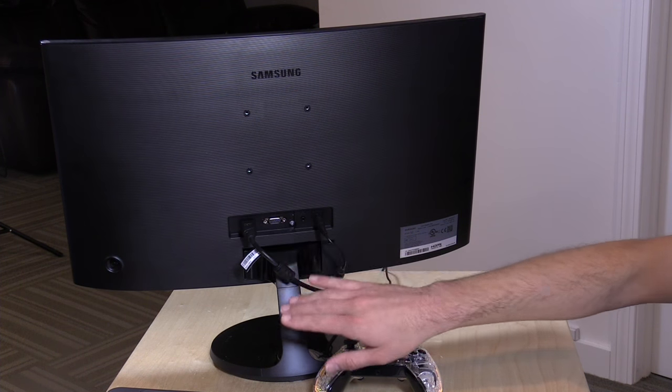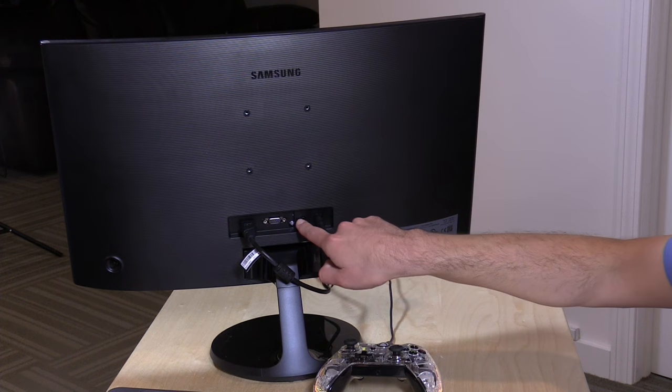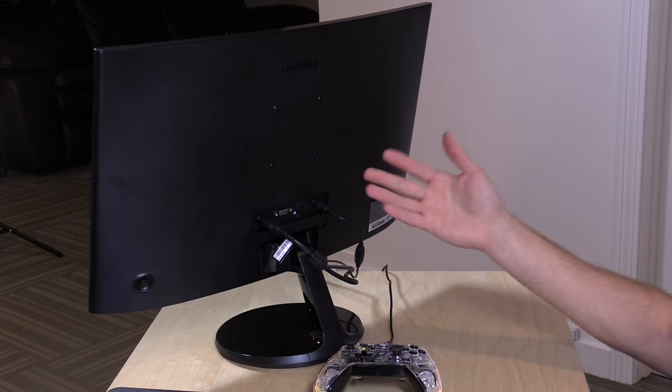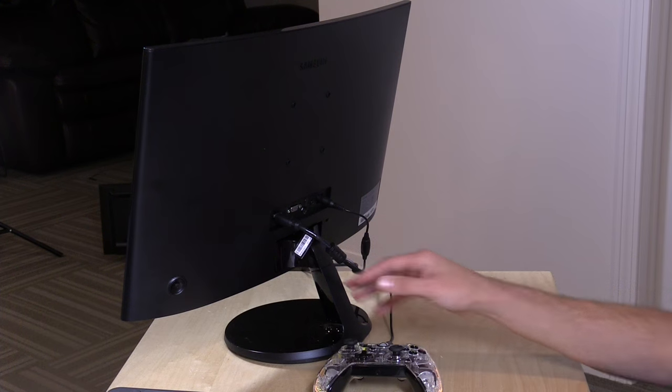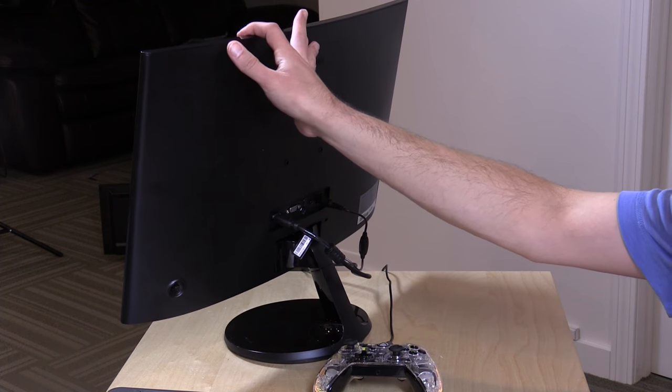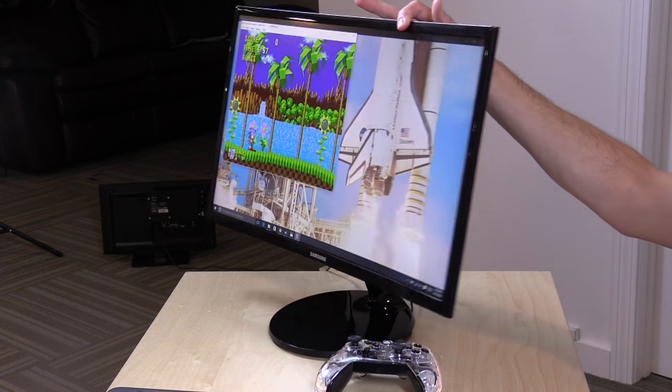There's an HDMI input and a VGA input, plus an audio output. There are no speakers on the display, but it does allow you to hook speakers up to it. I found when I hooked this up to my Mac that the Mac thought the monitor had speakers and disabled its own internal sound. So if you plug your laptop in and lose audio, you need to go into your settings and redirect it back to the laptop audio — or you can plug headphones or speakers into that port.